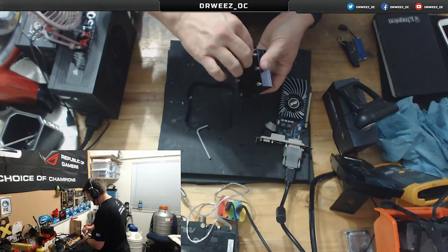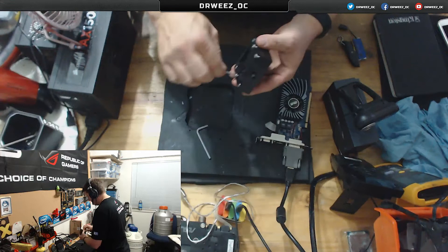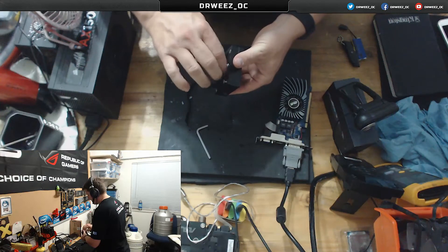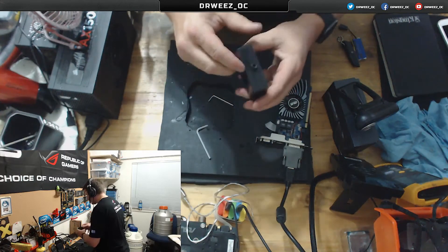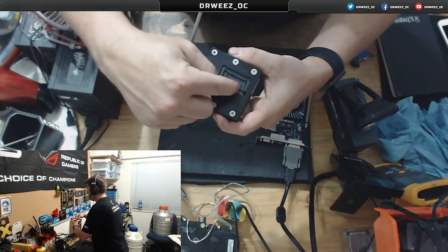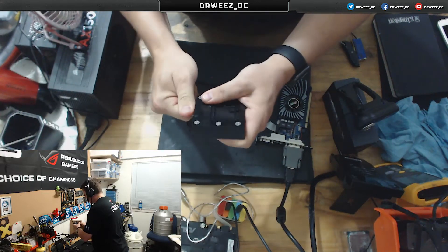Now it's really straightforward and easy to do. Once that's all tightened up, we've just got this screw at the end here which we tighten. That then pushes a piece of aluminium to dislodge the heatsink. There's a little inspection window where you can see the movement of the heatsink, to give you an indication of when you're done — but you should feel and hear a little pop when it's done.